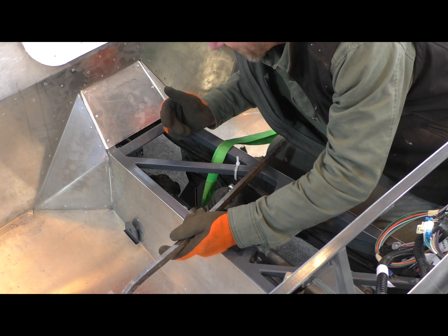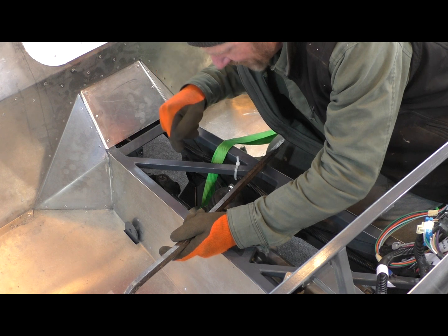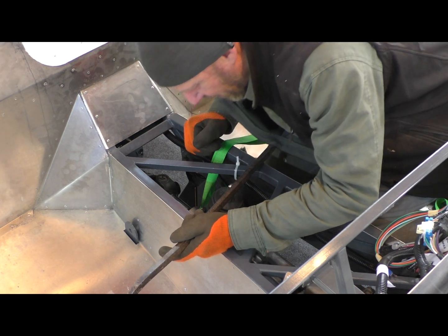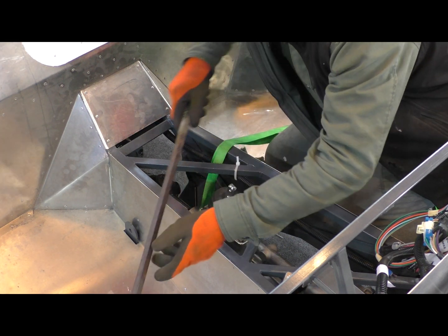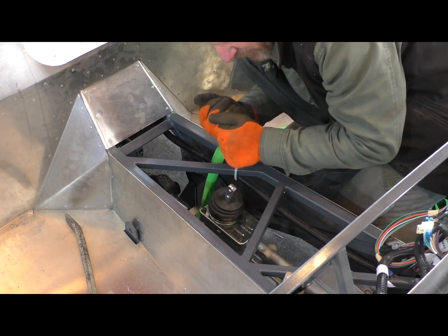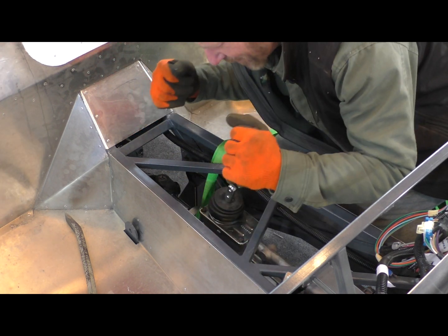appear to be enough clearance. But all it takes is, in this case, drop the transmission so it's sitting on the cross member. No transmission mount in there, just sitting right on the cross member. Using a crowbar, I was able to slide it over with the motor mounts loosened, and it went in.